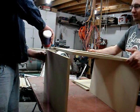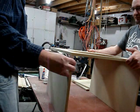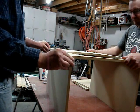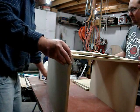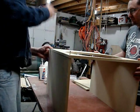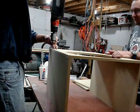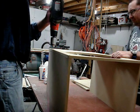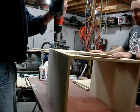Now we can proceed to doing the other side wall. Once the two side walls have been attached, it is quite easy to see how you would follow on with both ends and then, flipping the entire assembly over, attach the base. Once again we have run our bead of glue. We align our blocks of wood with each other and then place the screws in the guide holes finger tight. Now we use the power driver again and we drive the screws down to the surface of the wood. Now we drill the guide holes for the remaining screws to hold the baffle to the side walls. These holes should be spaced at approximately 4 inches apart.